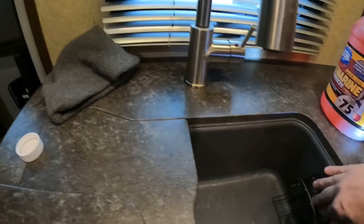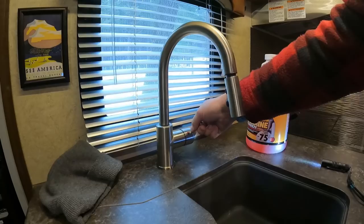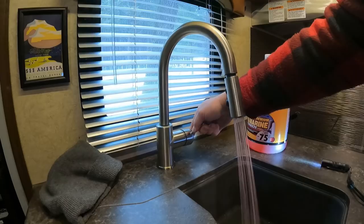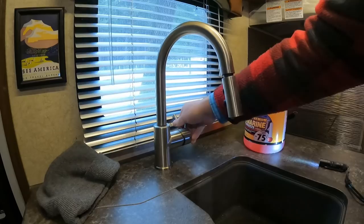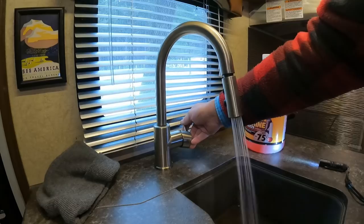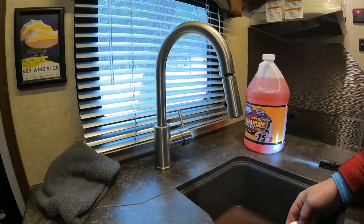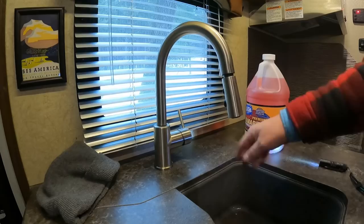I cannot believe I used to pay an RV dealership years ago like $60 or $65 to do this for us. So if you're finding value in this video, we'd sure appreciate it if you give it a thumbs up, and if you know another RVer who might find it useful, we'd appreciate it if you'd share it out to them as well. I'm going to start with the cold — a little bit of water, then pink. This is a good sign; if it wasn't flowing, we'd know something had frozen. But with the heat on in here, I was really comfortable. There's a little more water in there than I thought. We've got pink — it's draining, so that means we didn't freeze on the faucet.